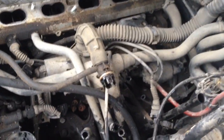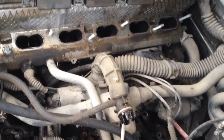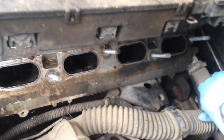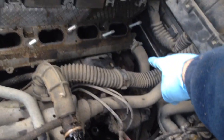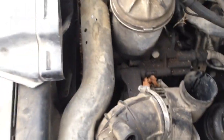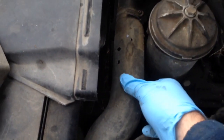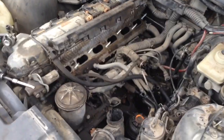This also allows you access to your starter. On the E36, all the M50 and M52 engines are really bad about blowing this hose on the back - it's kind of expanded out a little bit. That goes over to the heater valve; on the M52 that hose goes from the back of the head all the way over here, it's real long, and it loves to blow out. If that blows out on the highway you're pretty much done. Look how it's expanded - that top radiator hose was getting ready to blow out for sure. Tomorrow we're going to pull the fan and everything off the front and pull the valve cover off, and probably do a timing video if the weather permits.